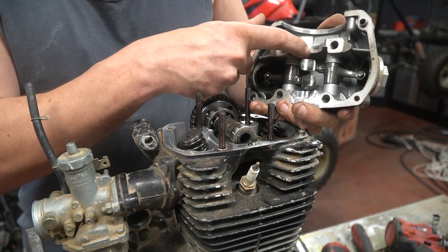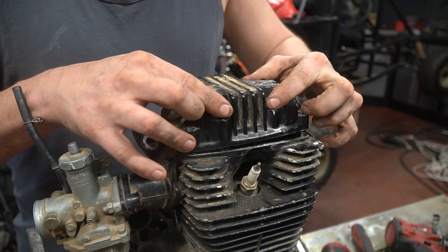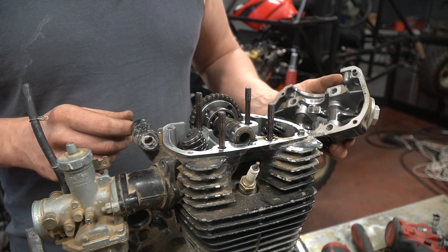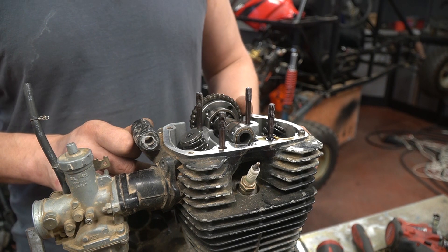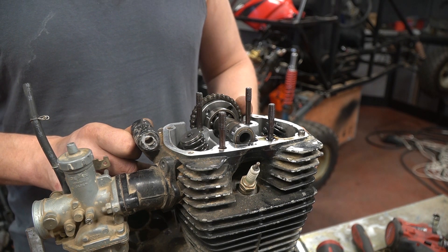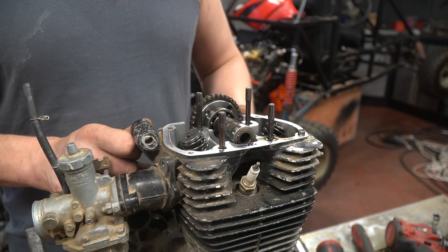Here's the top tip. This is a cam bearing, and under here is also a cam bearing. Before you even start adjusting your valves, loosen the bolts and torque them again — because firstly you don't know if the person before you did it, and secondly not all torque wrenches are created equal. The critical aspect is having consistent torque on all the bolts rather than torquing them to the exact spec. Because if you don't do this, you'll adjust your valves based on the old torque settings, and the result will be that you have to do it twice — after you measure them and close the engine, you'll find they're different to the values you expected, all because of the torque of this cam bearing.